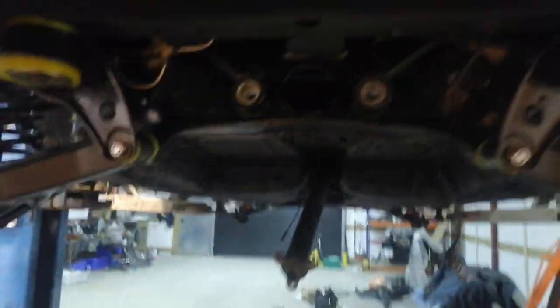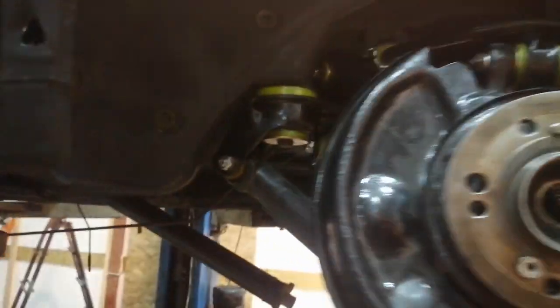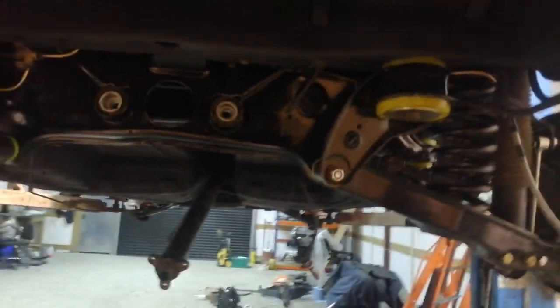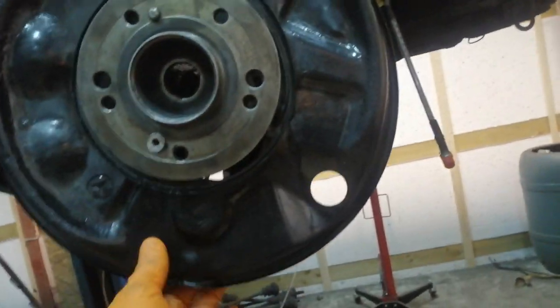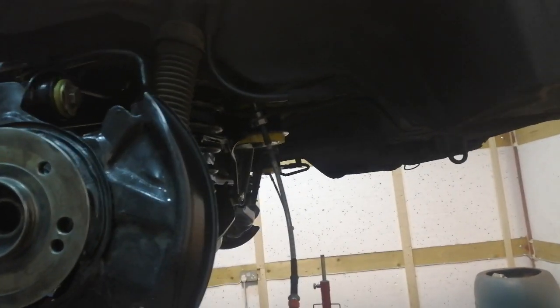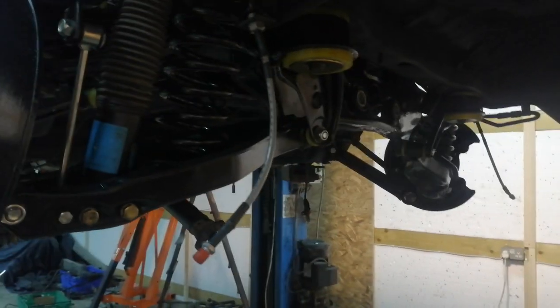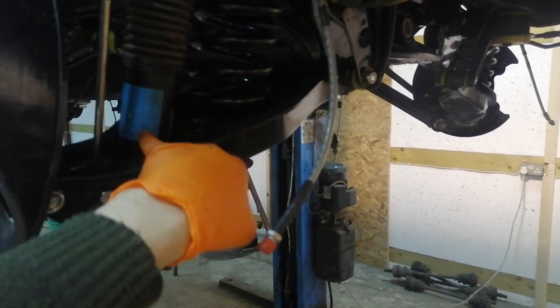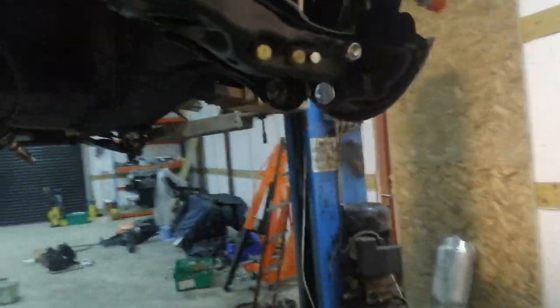And what I'll do now in a bit, after it's sat overnight, is go around and double check that the same 84 is clicking nicely on all four, because overnight it might have compressed and moved and settled a bit, and they might need another torque up. So aside from that, it went swimmingly. It is a bit of fighting, there's no getting around that, and you do have to watch that you're not going to damage these mounts here. But apart from that, it went swimmingly.